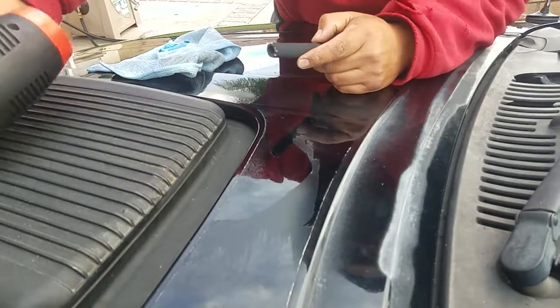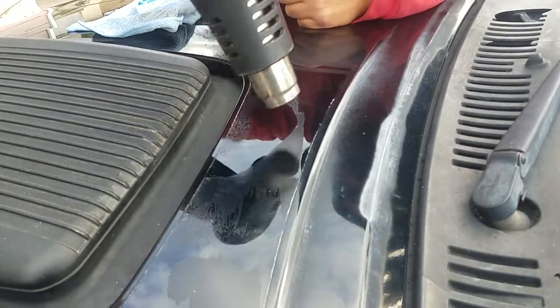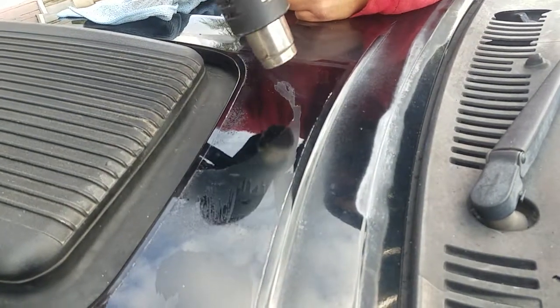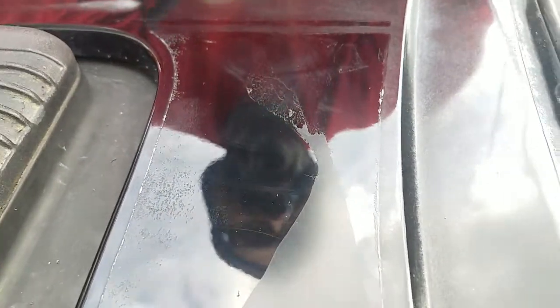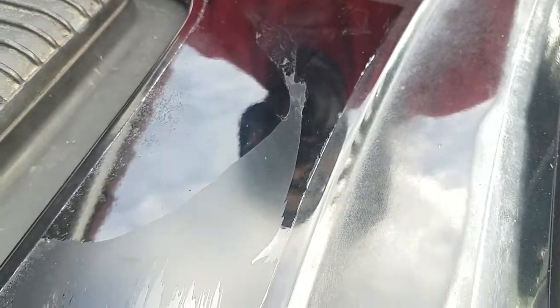So what do we do? Get the heat gun, keep it up a little bit, just enough to soften it up. Go over it, get about 10 seconds or so. Keep in mind that this is rubber, so it's not going to create any scratches in your paint if you do this right. Get your little rag, dust it off — here's that glue. If you try to do it with your nail, you can scratch it forever and scratch the paint, creating issues.